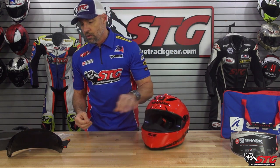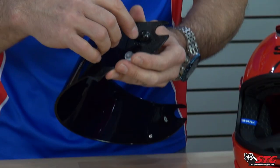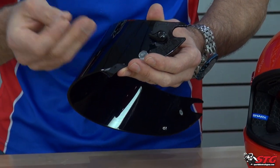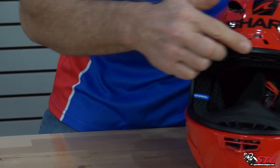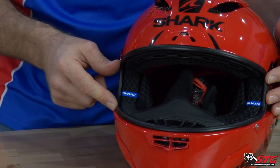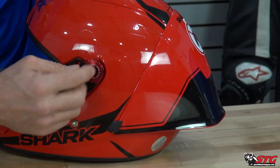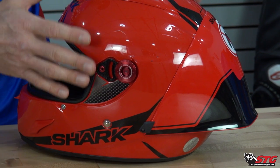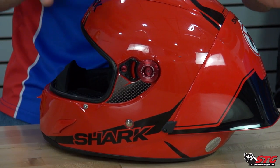To adjust the tension of the detents — and there's literature that comes with the helmet — there's a little screw right here. Righty tighty, lefty loosey. And then if you need to adjust how tightly the helmet shield seals, this is a cam — you're able to loosen this up, move this around, and change the position of the shield. The likelihood of you having to do that is probably not very high.